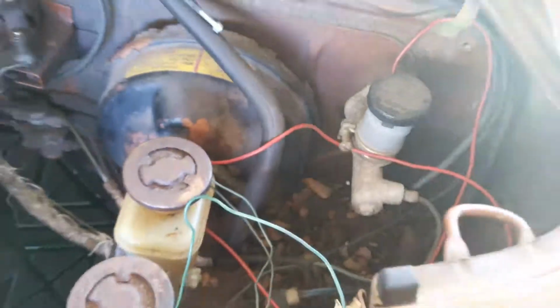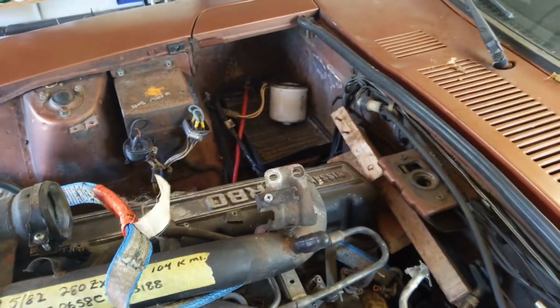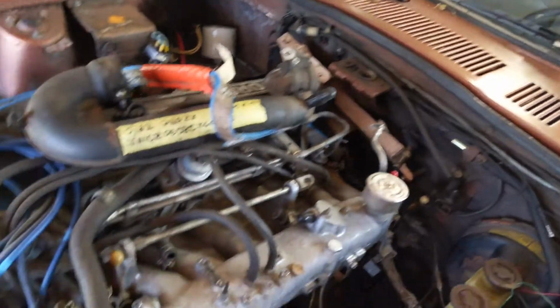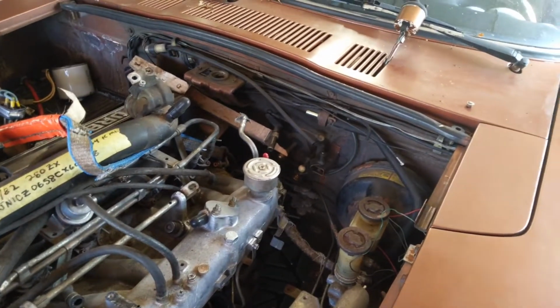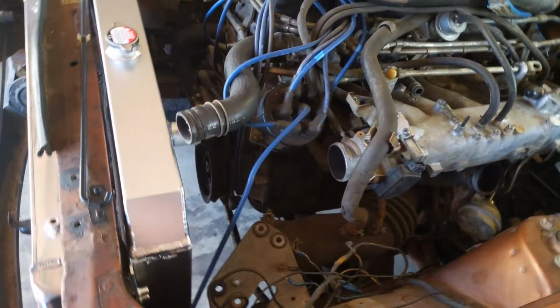You can see this hole right down there was where the wiring harness went through. This was actually incredibly easy. Everything that plugs in was just sitting right here. There's one wire though that does run all the way over to that junction box that you have to unplug, and then the wiring harness literally just pulls out through the engine bay once you unplug it from the ECU. It's really nice that it's all a separate thing from the actual dash wiring harness, so I'm very thankful for that. Long story short, that only took me about 20 to 30 minutes, so I wouldn't worry about that part. If you do plan on ordering the MegaSquirt kit, don't worry about the wiring harness part, because I was scared of it, and it was pretty easy.